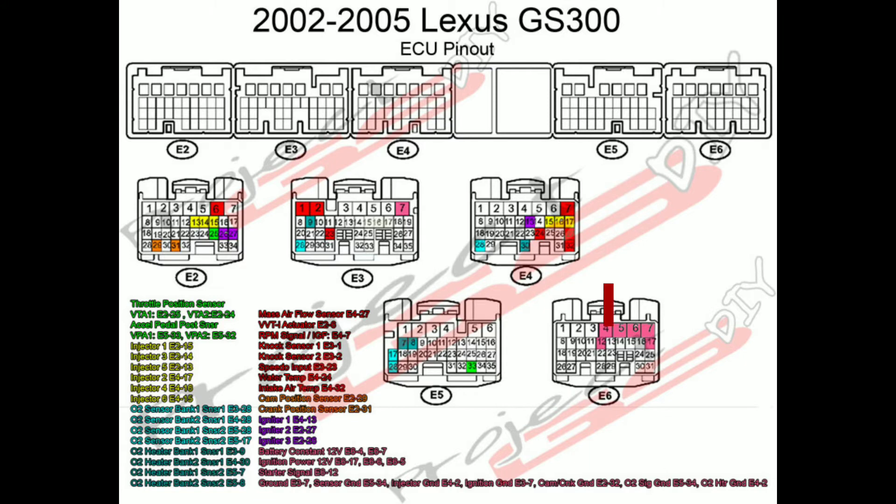It'll be marked in the diagram — I might get some of these numbers wrong because I'm looking at them backwards. The yellow-black wire should be your RPM signal — E4, that's pin 22.